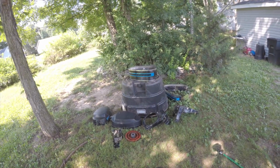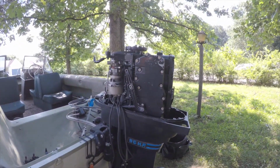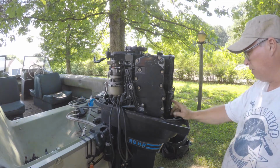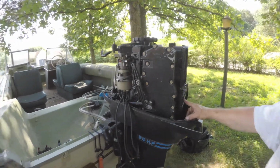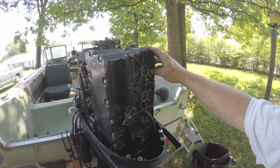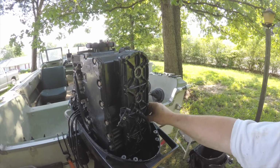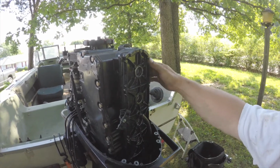So anyway, yeah, it's an 850. So I did a compression test, and I mean, it's a good power head. On one of them, it's even at like 171 pounds of compression. I have to go get my numbers, but it was kind of odd. It was like 136 or something, 140, 170, and then it was like 136. So I don't know, something like that.